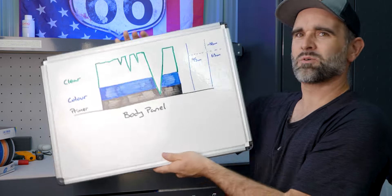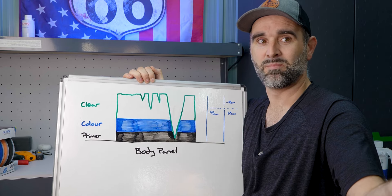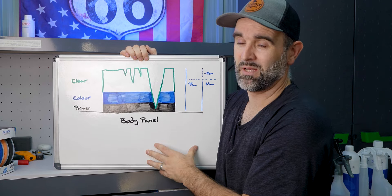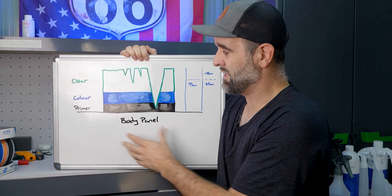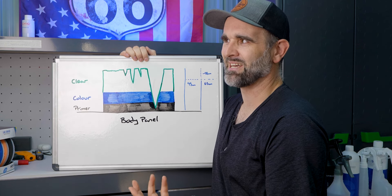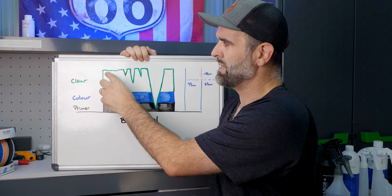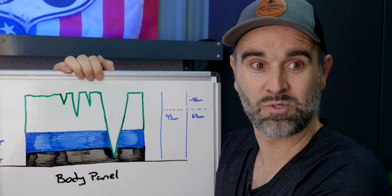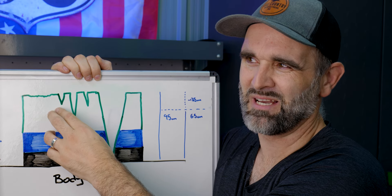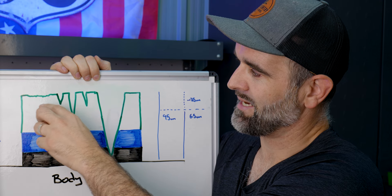So I've got this diagram at the back and we'll quickly talk about what we're doing. Over here we've got the clear coat, we've got the color - a blue panel - and the primer. This is typically how your paint is made up, with the body panel below, which could be metal, fiberglass, carbon fiber, or plastic. Over here you've got your typical swirls and marring - the light scratches that pick up day to day. You can get polishes that fill these, like glazers, and essentially you mask them. These are the deeper swirls and scratches from brushing hedges and things, and you can polish these away by leveling down the lacquer.